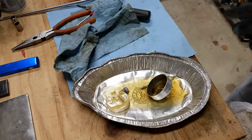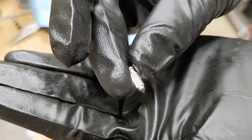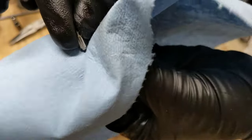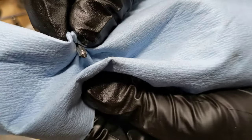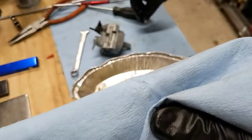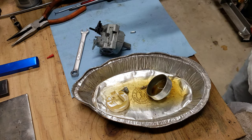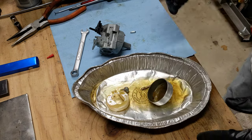I'm satisfied. The needle with the rubber float tip — I took that out of the pan. I don't want it sitting in the carb cleaner because it can cause the tip to swell and deform. I took it out and put it on the towel. Now let's get the jet cleaned up.